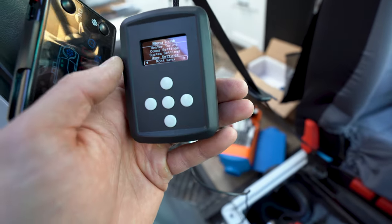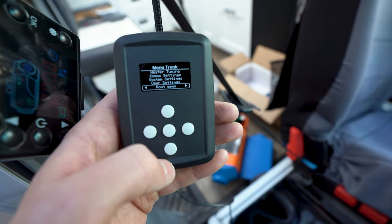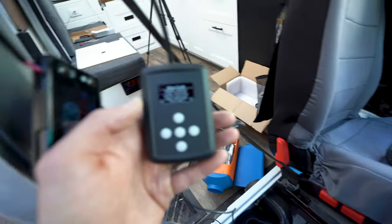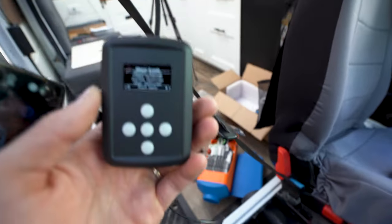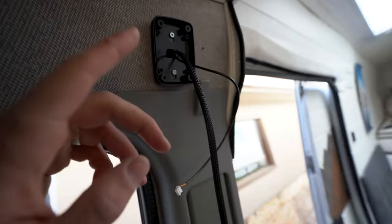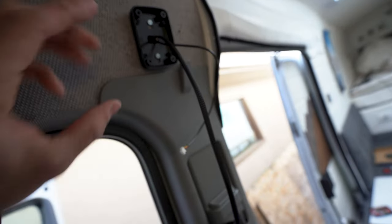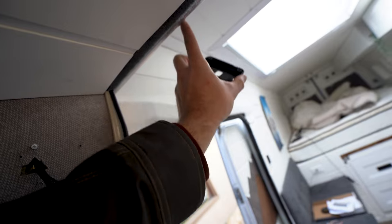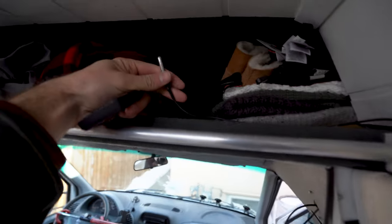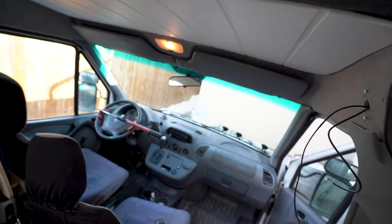That was super straightforward — very easy to transfer the parameters from your existing controller to this one. I'm not going to go through it step by step; it's very straightforward and will take you just a few seconds to read through. I'm going to disconnect the power, disconnect my old controller, install the new one, put in a couple screws, run the temperature sensor, and fire it up. I unscrewed the top piece to do this properly — definitely recommend doing that. Temperature sensor is placed just on the other side, which is a lot better than the front, especially since pulling our curtain creates a big temperature difference between the cab and the back.